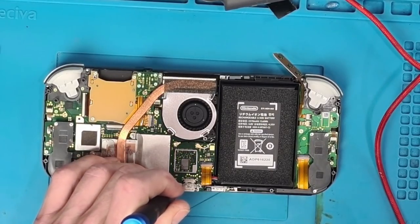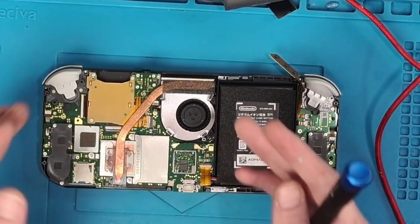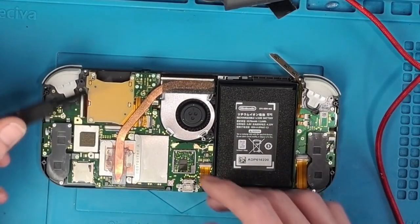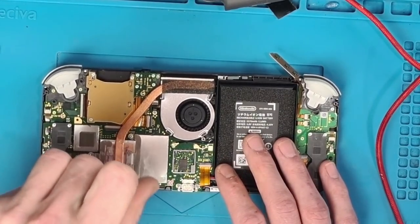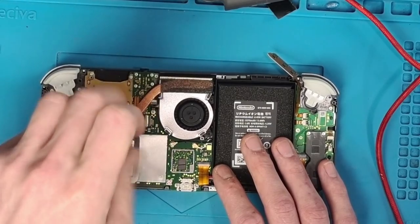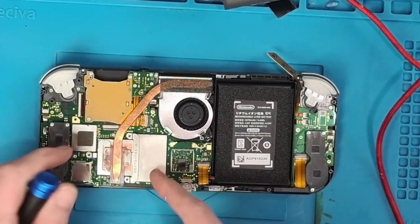If there's an internal short on the USB port, it's basically going to draw as much current as it can possibly pull, because there's no resistance — it's a direct short, a dead short. There's no traces in between; it's just a metal-on-metal short, and that's what's causing the very high current draw. I've got a feeling that the power management IC is going to be damaged as well, given the fact that the console is drawing such high current — it's probably fried the M92T36 chip. Which isn't that much of a problem if it's just that chip, or if it's just the port. But it just depends whether it's done any more damage in the process.